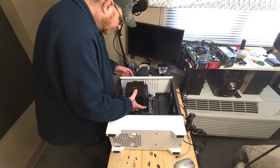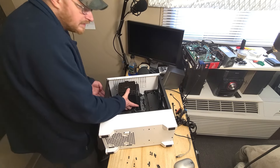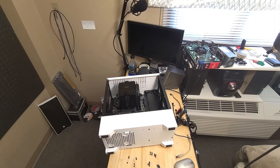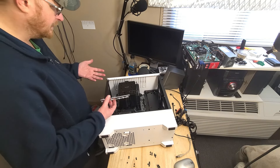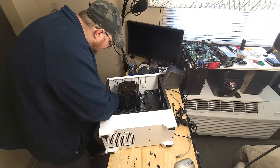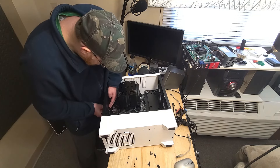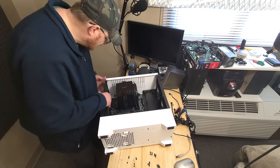I ended up with 3200MHz RAM. The RAM I would have gotten would have been 3600MHz CL18, but I ended up ordering a 32GB kit that runs at 3200MHz but it's CL16. I also need to grab that back plate which is still on the case.